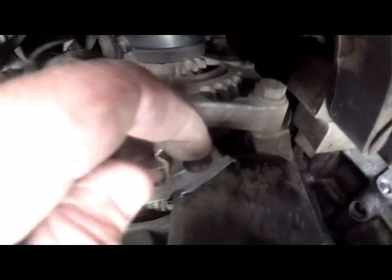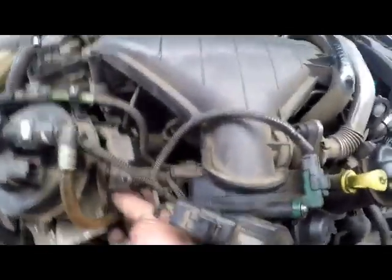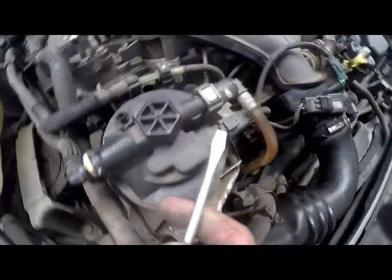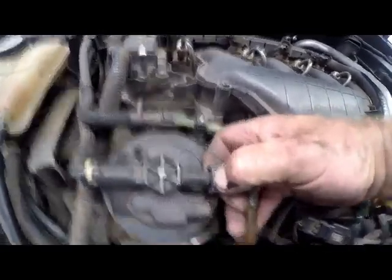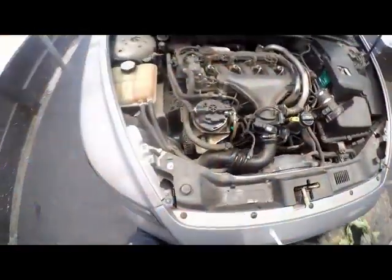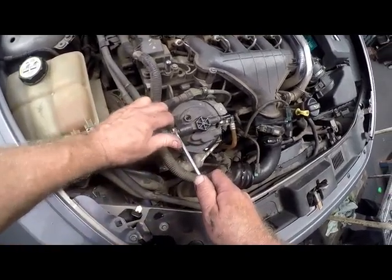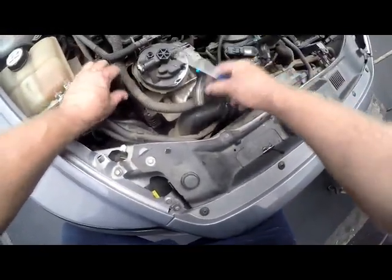Here's a little bracket with a torx screw — we'll turn that out. Now we need to disconnect the inlet pipe and the outlet pipe. There is also a sensor on the side which we need to turn out. You just need to lift up a little lip to unlock it, and the same with the bottom one — pull out the two sensors. For the inlet pipe, take a screwdriver, gently press down on the white section, unlock the clip, and then pull the pipe out. Be gentle with everything — you don't want to break anything.